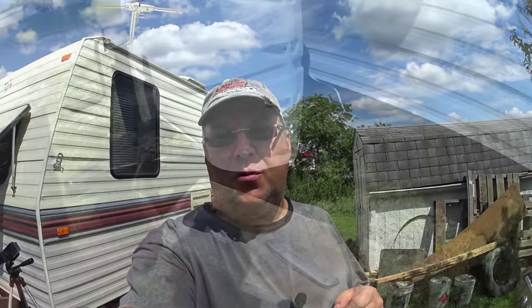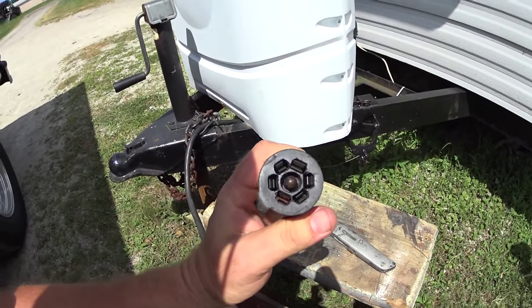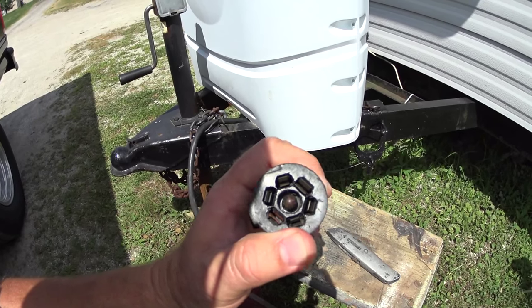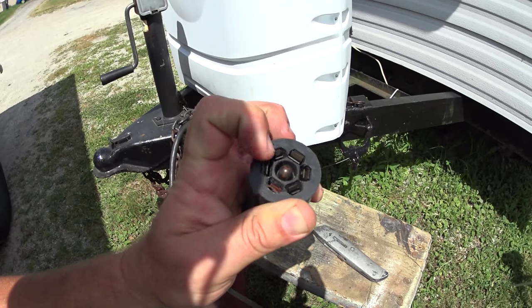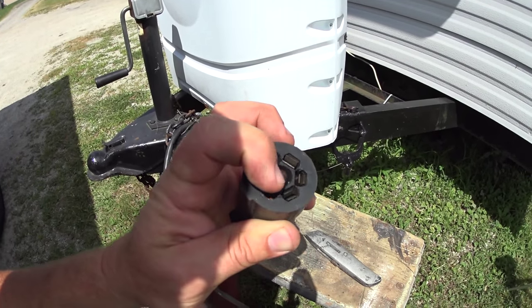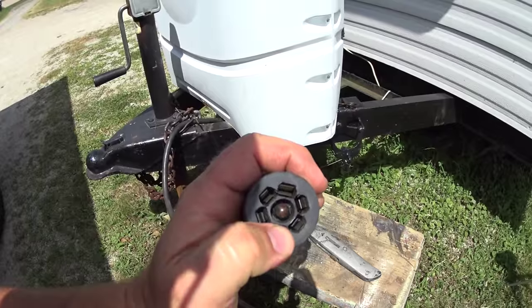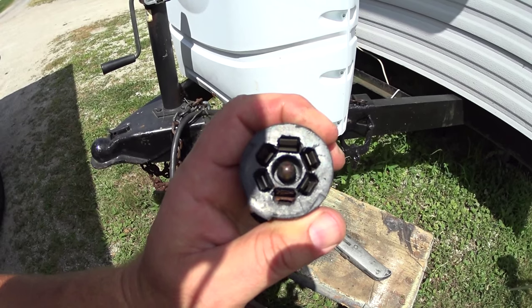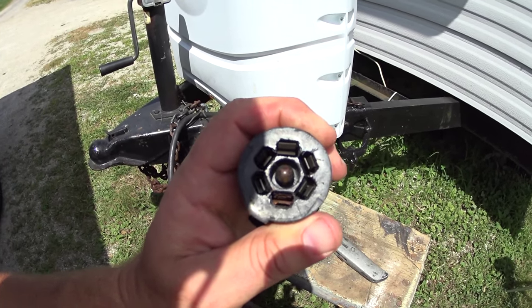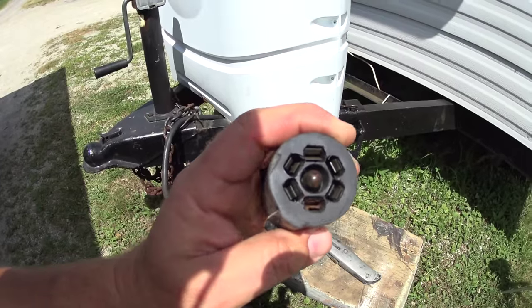Right now this video is going to be on my trailer plug on the camper — the replacement to put a new end on it. I'm going to show you what that looks like, so let's get up close and personal. You can see how there are a couple of terminals in here that are bigger than the rest. These four smaller ones and these big ones are more critical, and you can see this big one here is just shot — it's deteriorated past its use. I can kind of get it to connect but not very well, so it's time to replace this.